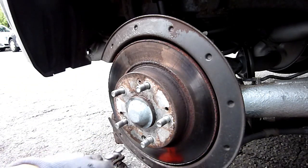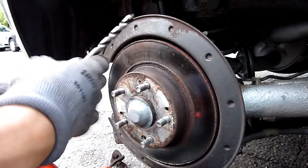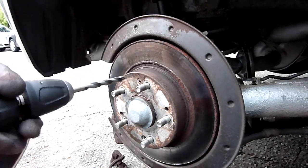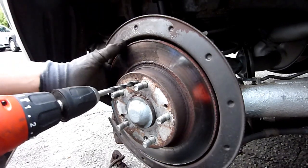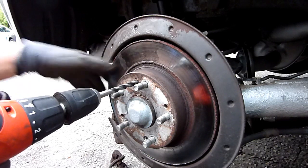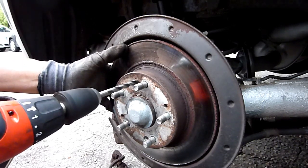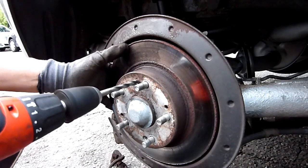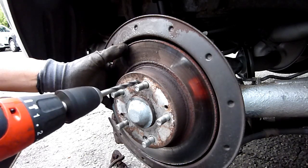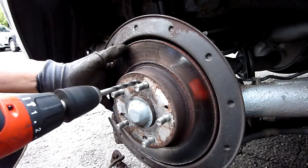I've got a really big — this must be a 10mm. Safety glasses and gloves on. You should really do this with all the brakes on — it would be easier — but I'm just going to round that off. This is a high-speed steel drill bit, but usually they're not good enough, so I'm just rounding off so the drill bit doesn't catch.